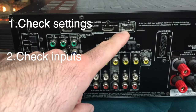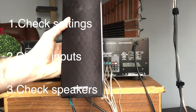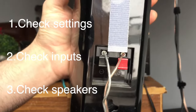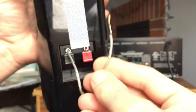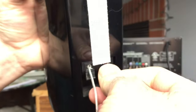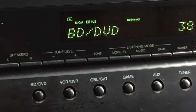If it's coming from an HDMI input, check your HDMI — give everything a little wiggle and make sure everything is installed physically. Third, check your speakers to make sure they're actually plugged in properly. If you haven't moved them, the chances are next to none, but if you've been moving things around, give them a check to narrow down the list. Maybe one just came out and needs to go back in, or your stereo could just be in the wrong settings and needs to be reconfigured.